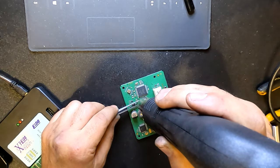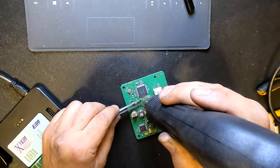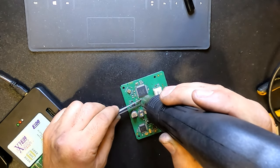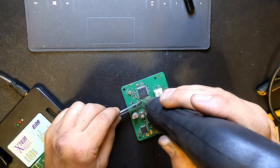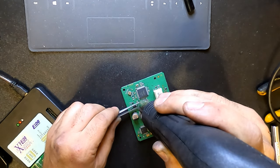I had a problem reading with the machine. It said there were all the airbags, of course, because there are no seats, so there are no airbags put into the car. Also, I had an EEPROM error and a crash detected in the DTC count.